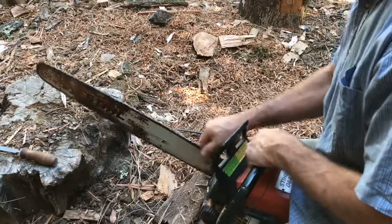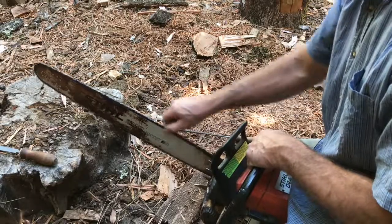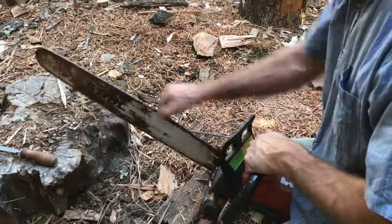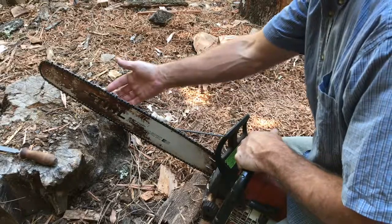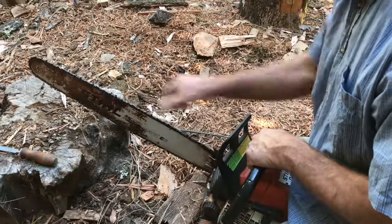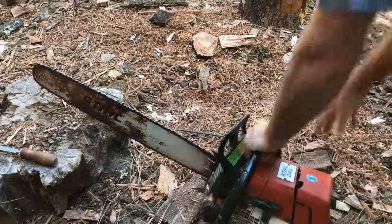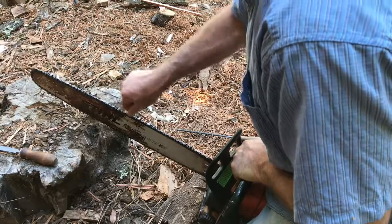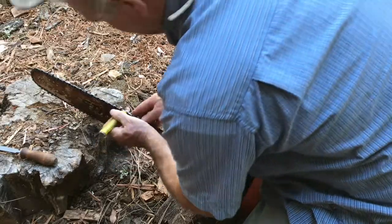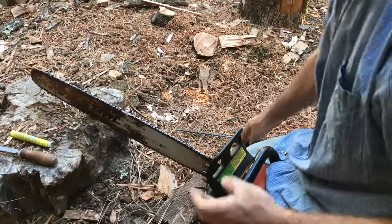Sharpening is very visual. You have to see your chain, and you want to see the condition of your chain. And so what I do is you need a starting point. I usually use the offset link, usually one of these where the chain is hooked together, there's like an offset where there's an extra link. This was made perfectly. It has no offset. They're all uniform and balanced. So what I usually do is I put a mark in here with my chalk. I just put a mark on there. And that'll remind me, this is a paint stick. It'll kind of work. I just need a mark so that when I come back around to this area, I know where I started.